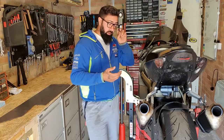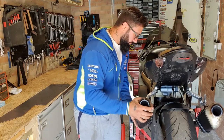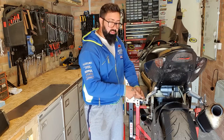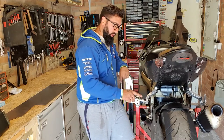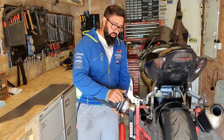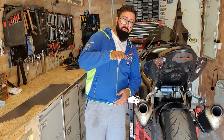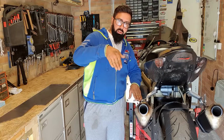I've spent quite a bit of time today here in the garage thinking and trying to come up with a solution. My first idea was to simply drill the footpeg through the back or through this side — right in the center inside where this little peg swivels — drill a hole and put a bolt and a nut and put the bracket off of there. It would be a very simple bracket that would come from there to there, one bolt there, one bolt there and that would be it. But the way this is, it means the bracket would literally be on a flat level, and any little pressure on the exhaust itself, it would just tilt the bracket down.